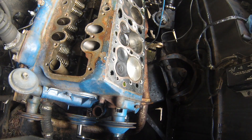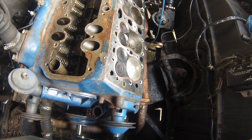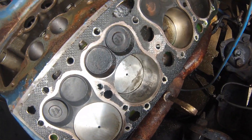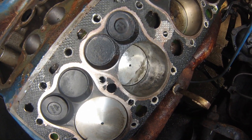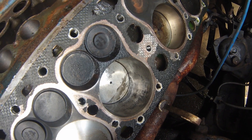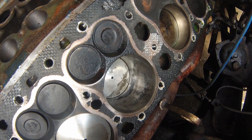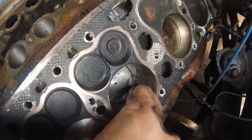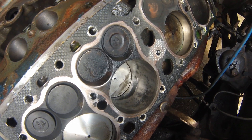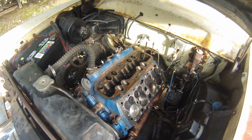I'm going to check the rest of the sides, and then I'll probably just pull that other head off — in for a penny, in for a pound. You can see that cylinder there at number six — that's where the rust was, and you can see that's where the piston was sitting. Looks pretty bad. The hone job got rid of the rust but didn't get rid of the divot. Anyway, that's about it on this one.